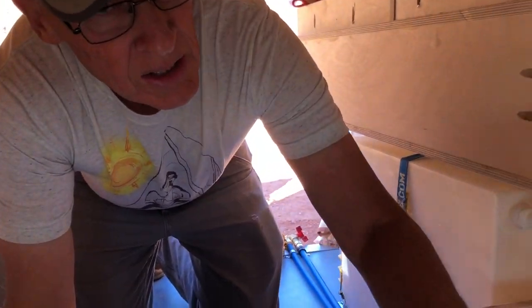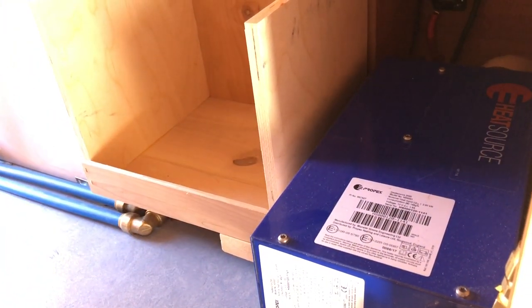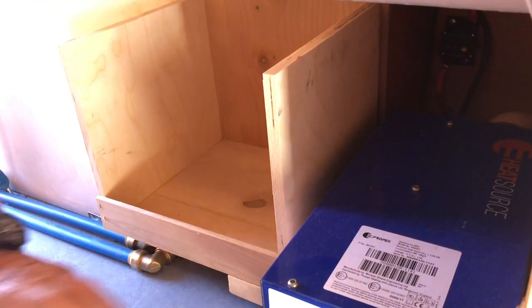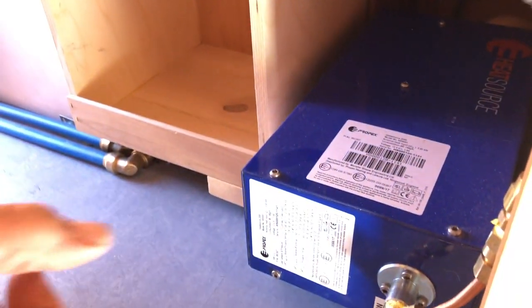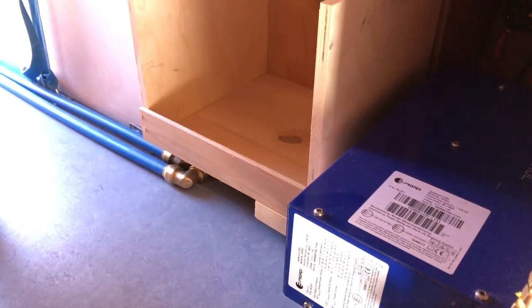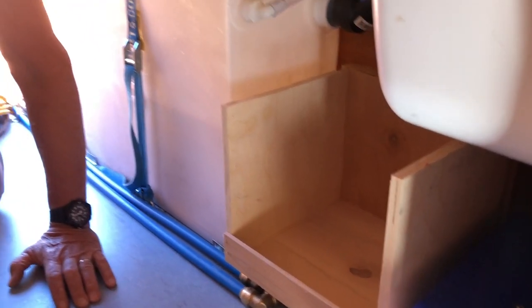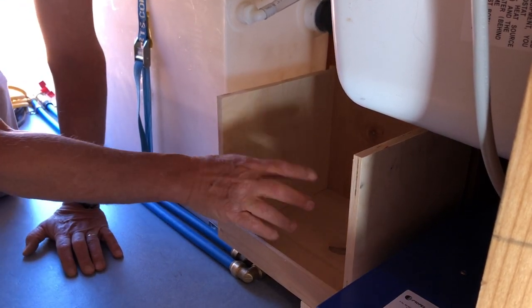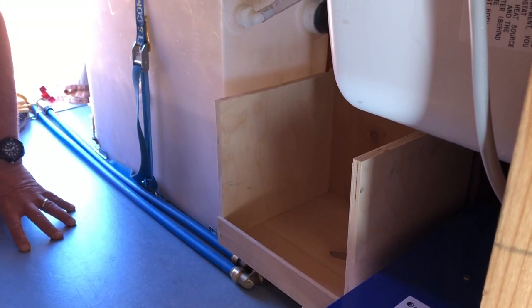And then down here on this side, I showed you the water heater, and right under the water heater is our Propex furnace, Propex heater, which is direct vent, vents through the bottom of the van, and then the heat is ducted over to come out right underneath the sink and the toe kicks, so it keeps the floor warm. This piece here, I can put the floor levelers in there, fits right in there. Also, my little 5-pound propane tank fits right in there, so that's kind of multi-use. There are a lot of things that we could store in there.